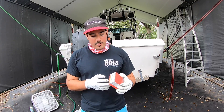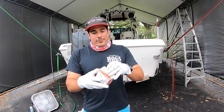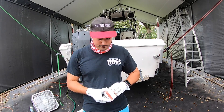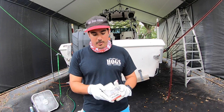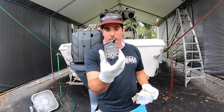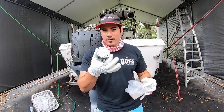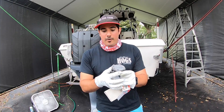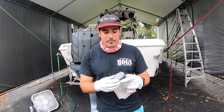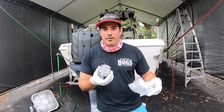For just a couple dollars more — I think it came out just below $50 — we bought the entire low-pressure fuel pump with all new gaskets inside. Basically plug-and-play, it makes the job a lot easier. All we really needed to do was remove two bolts and two tie wraps, and we're back in business.